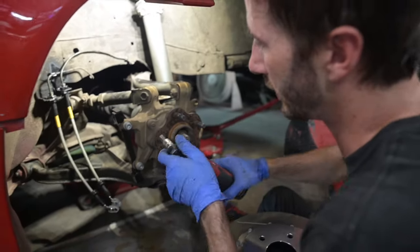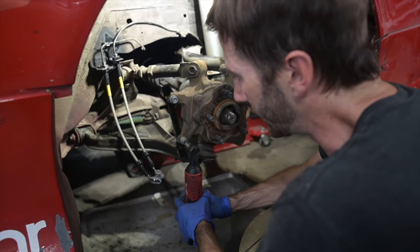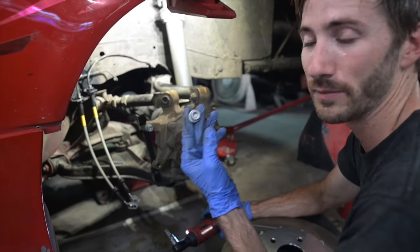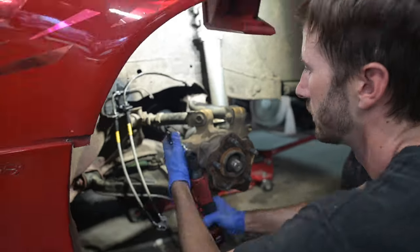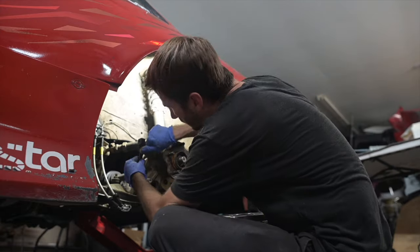But yeah, make sure you get the red Loctite on here. Very, very important step. And then you want to torque it to the appropriate amount. It might be on CEiKA's website. You can also just look up the size and grade of the bolt that you're using, and it will have a universal torque spec. Three shims. CEiKA Loctite straight from France.